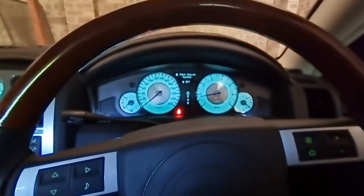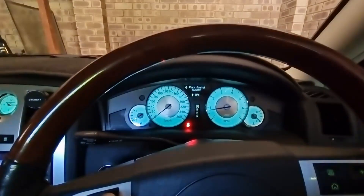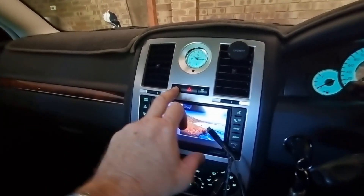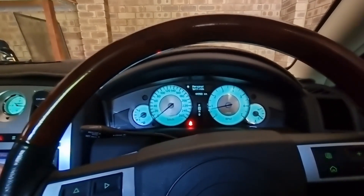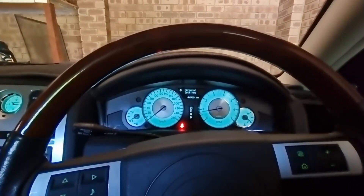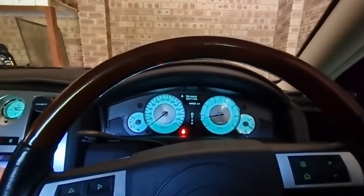We're running up again and I can't turn Park Assist on. There's a switch here as well — it turns it off, and conceivably it'll turn it back on. I think that's pretty much this journey over for now. I will order a new Park Assist module. That's effectively ruled out the only mode of failure that I know of, which is that reed switch at the back. So for those of you who've got Park Assist issues, do try that fix with the reed switch first before you replace your module. Thanks for watching.